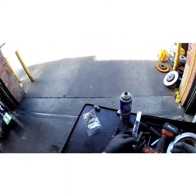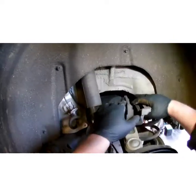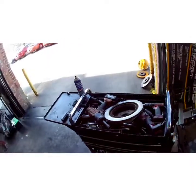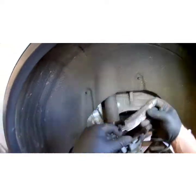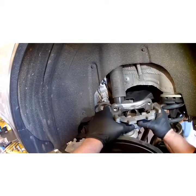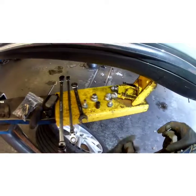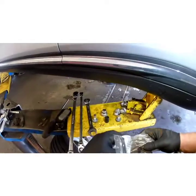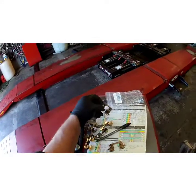Let me go ahead and grab my brake pads and the hardware — I'm going to change the hardware because this thing's grinding. Hardware that is all gummed up with brake dust and crap can cause the pads to stick. Double flathead action — pop that pad out of there. See how I pulled that off with both slides still attached? Did that to change the hardware. Top and bottom are the same. Let's dump all this out because they give you several different options for different makes and models.